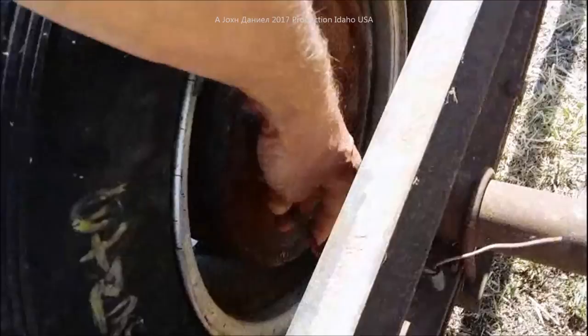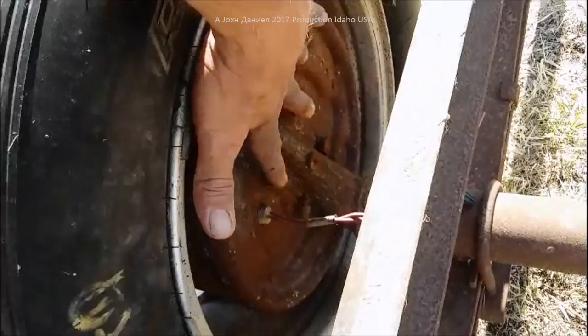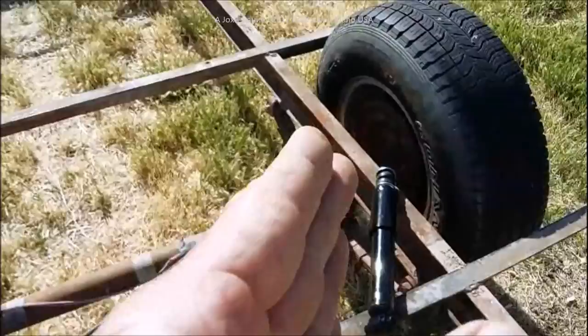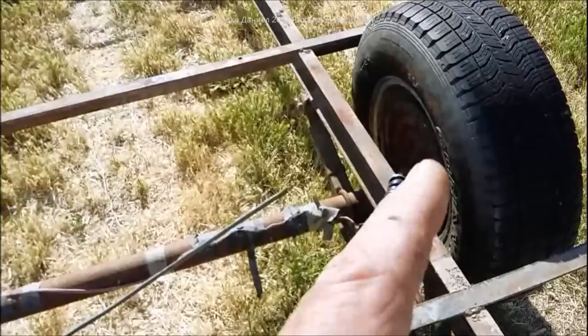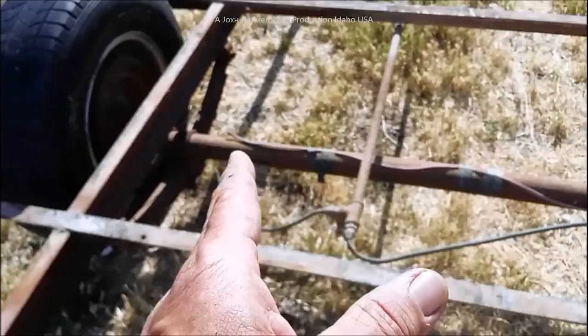Later you'll see me wire up the brakes on this. We're probably going to replace the brakes if they're not new enough, and we'll be replacing the bearings. You can identify a 3,500 pound axle by the brake plate mounting location. If you have a five, it's 5,200 pounds or greater. If you're looking at doing work using an old salvage frame like this, look at some of my other videos — and don't forget to comment if you have a question.